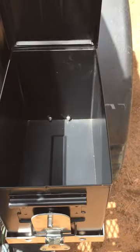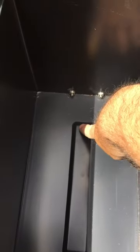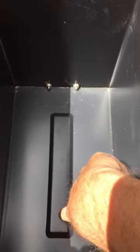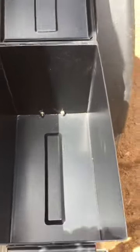Pop it open. The only problem I did come across — and it wasn't a big deal — was the Swag Off-Road bolt holes were drilled right at the very edges of this recess. I don't know if it's Quadratec or if mine are just slightly off. It wasn't a big deal; the aluminum is easy to drill through, so I just drilled two new bolt holes a little more center and lined everything up.